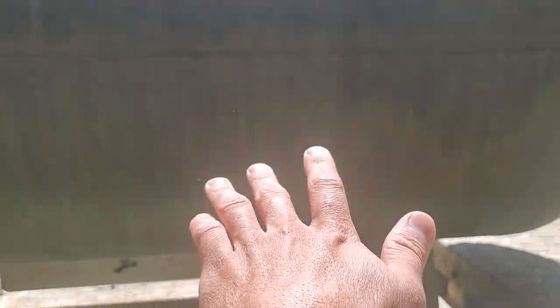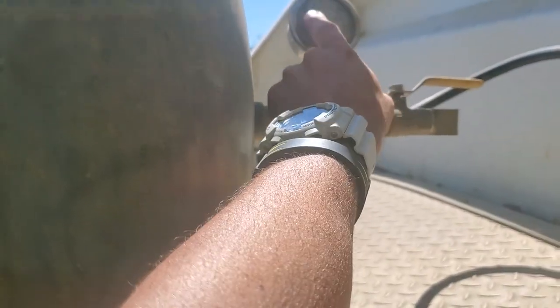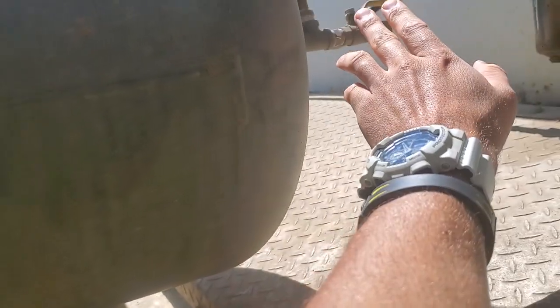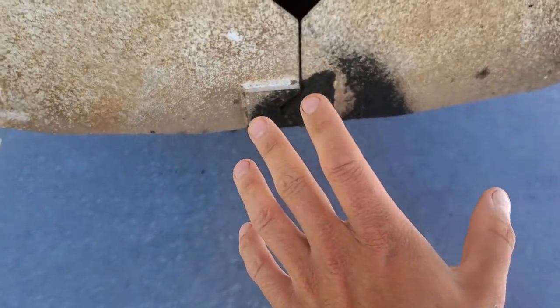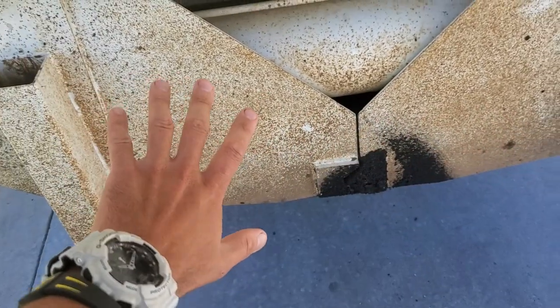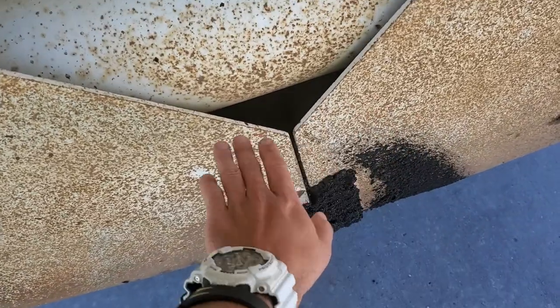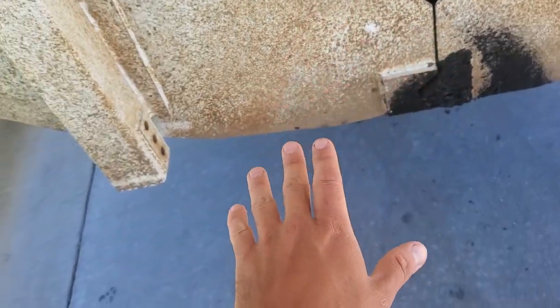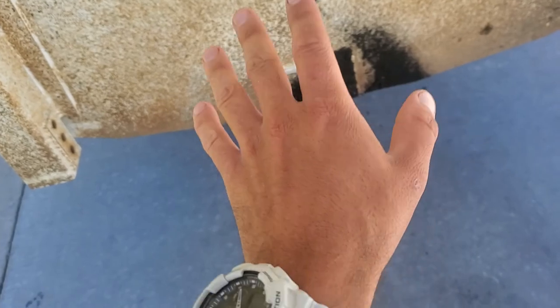This right here is your air tank for the trailer. We're at roughly 120 — you want to have at least 100 pounds. It takes a while for that to fill up. When you press your button, it basically releases all that pressure out of the cylinder, which then opens this by force — just opens up. So pressure is what is keeping this closed right now, the air pressure in the cylinder tanks. That's basically how it works.